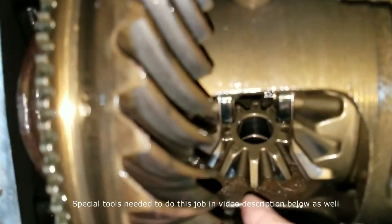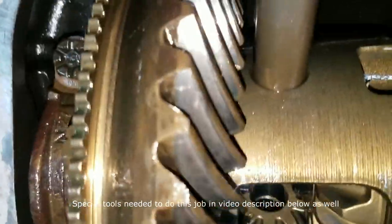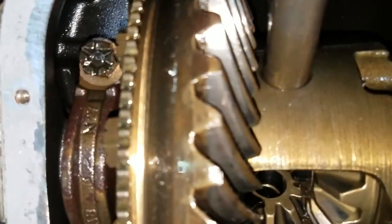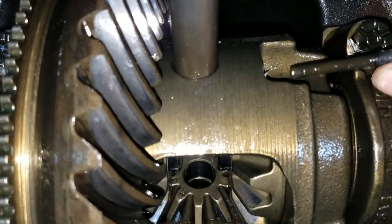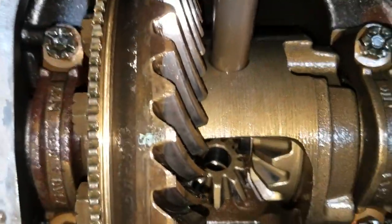You're going to have to pull this center pin and then push both axles in from the wheel side — push them directly in and there are two c-clips that will just fall right out. There's a bolt holding the pin in place; once you remove that bolt you pop the centering pin out, push both axles inward, and those c-clips will fall right out.